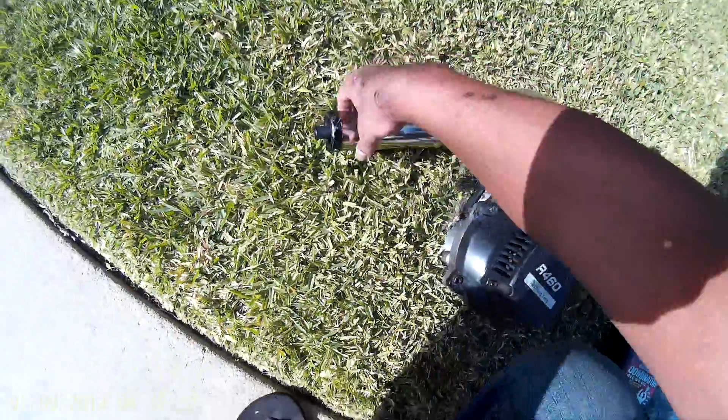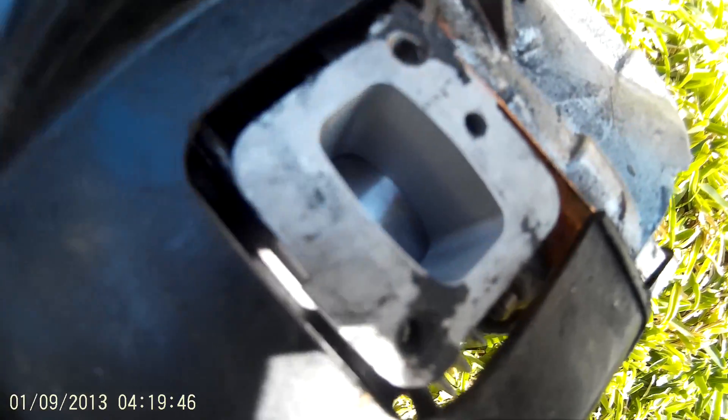I'm going to show you guys what I mean — this is the new ESP cylinder head, the one I originally had. When I say clean, I mean the cylinder is still immaculately new. There's no scuffing, no burn marks, no scarring — nothing. It's a beautiful cylinder. You can see all that Amsoil red on there — buttery. That says a lot.